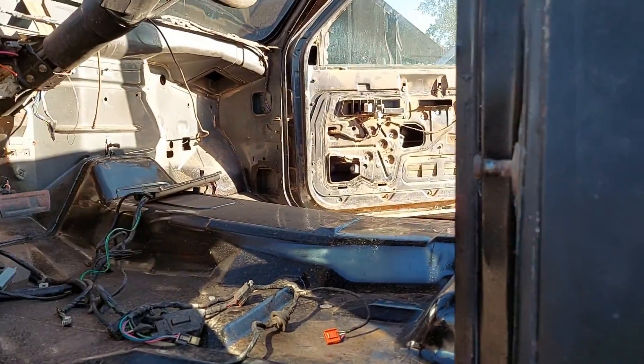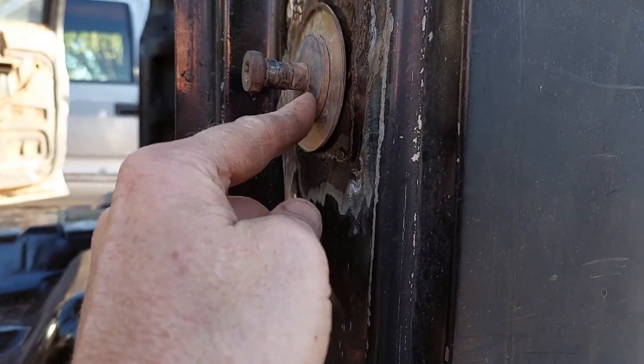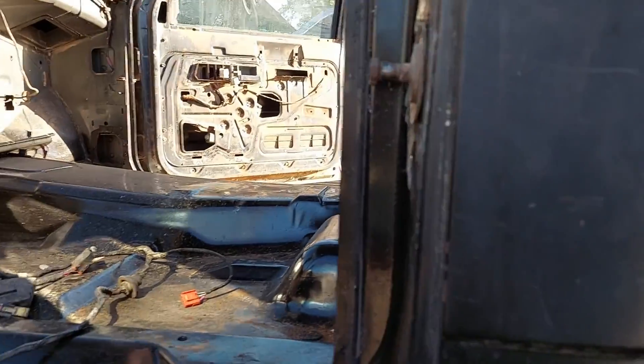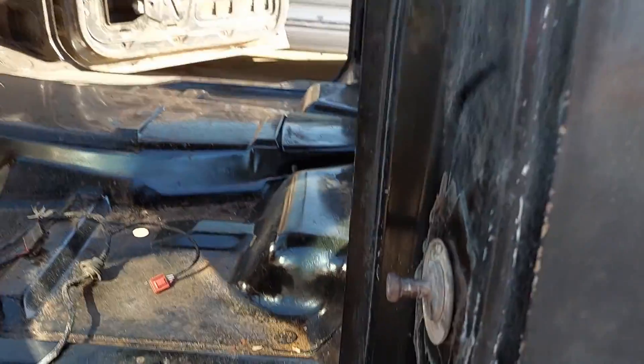This is the first try. There's no gap here — this is actually tight to the bolt. You can see the panel alignment is offset because the door hinges are sagging, but if I fix the door hinges this is not going to line up. So I'm going to go one size bigger on the hole and move this up and see where that gets me.